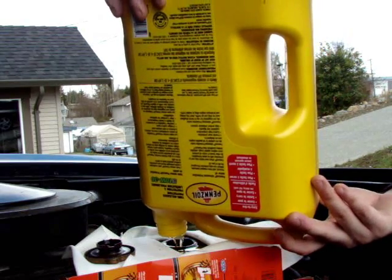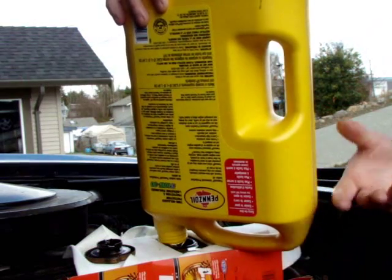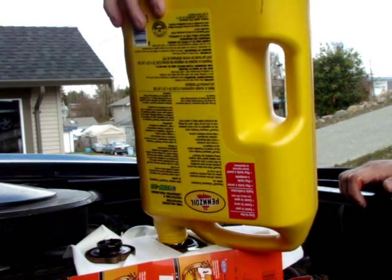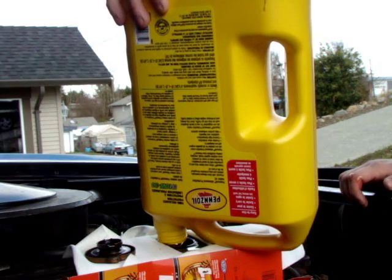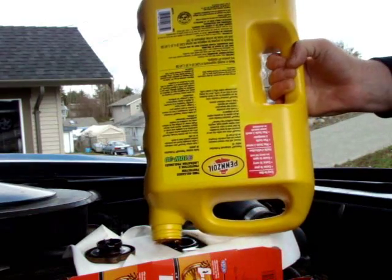That's all there is to it. So yeah, let the oil finish pouring out, and that's pretty much it. I'd recommend leaving it for 10-15 minutes maybe before you take it for a run. Just let the oil settle in a little bit, and that's pretty much it. That's your oil change. Oil, air filter. Don't forget, possibly get a cabin filter.